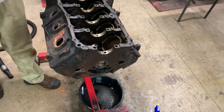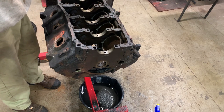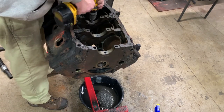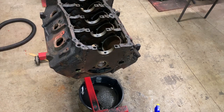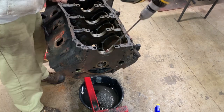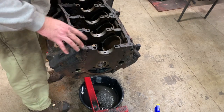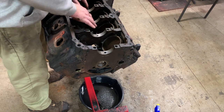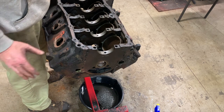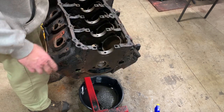Since you don't need to drill the mains on the big block generally, all I'm going to do is chamfer the holes just like I did on the previous one. The big block is much easier because you don't have to drill the center three mains — they're already pretty big. If you want, you can go out to the next size bigger, but I haven't found it necessary as long as you feed it enough oil.